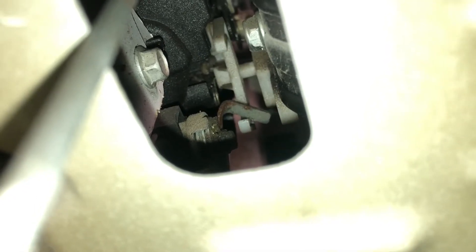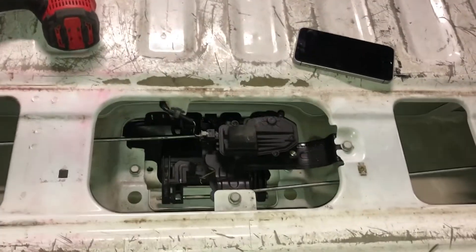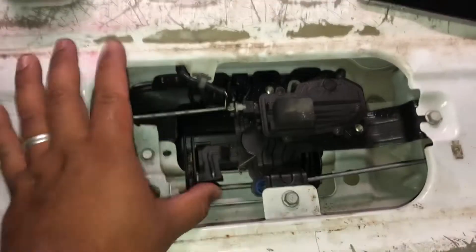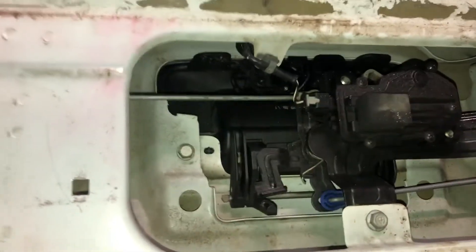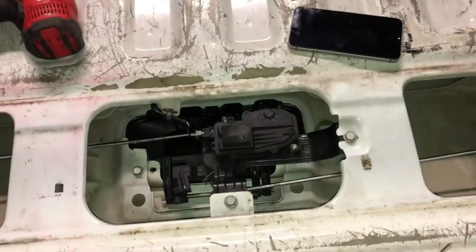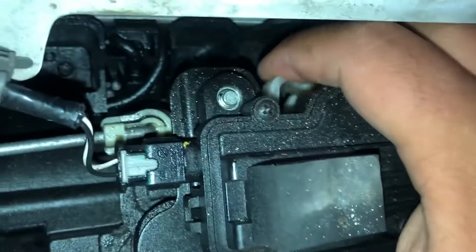Here's the view from the inside — it wants to work but it's not. What's really interesting is that the tailgate handle itself is in lock mode. The way it works is pulling the handle allows this to move freely down, whereas these little rods — you'd want them to actuate out or in so the tailgate can open. It's real easy to open from the inside, super simple. But the solenoid, this little white piece, it moves freely and almost seems loose on initial inspection.